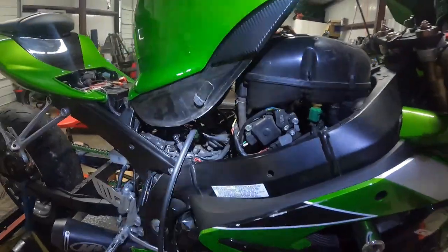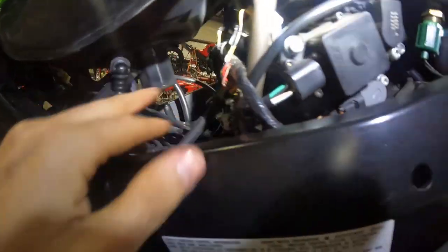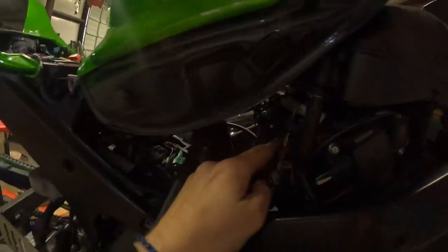We're back — I've got my headlamp on here so we can see what we're doing. So your fuel hose here goes from the pump to your fuel rail and delivers fuel to the injectors. What you do is you have your fuel hose here — we've got it run down to this measuring cup. You can get these from the dollar store. That's all you need to do the test.